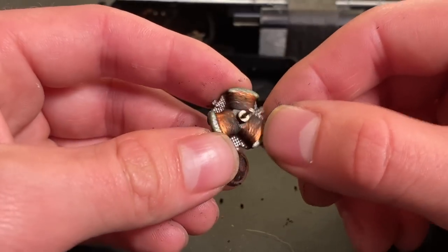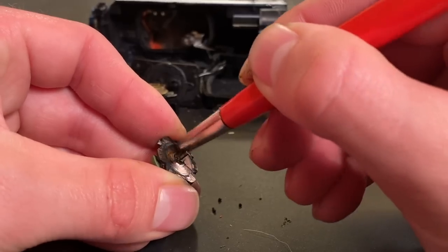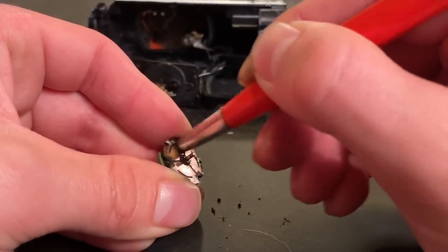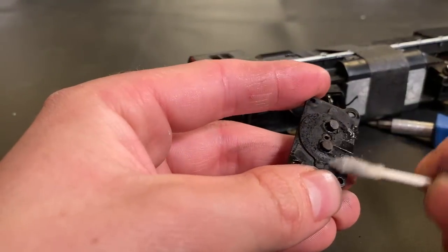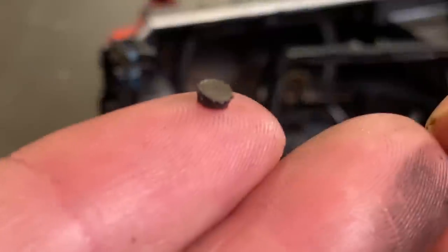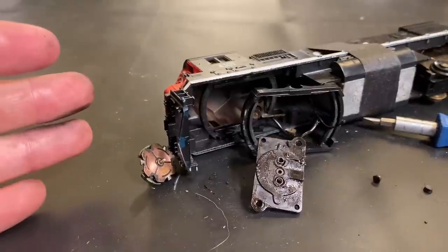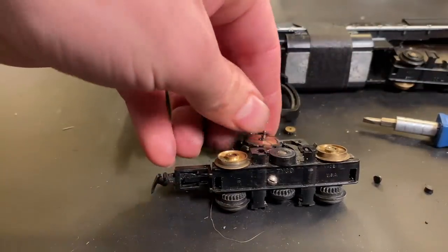This is definitely a motor which has overheated at some point, but it was running, so I think we're just going to clean it up and hopefully this motor will still work. Let's try to remove a lot of the carbon buildup. I suspect the reason there's so much carbon buildup is probably because this engine did a lot of miles - somebody really just ran the bejesus out of it. I'm going to quickly try to clean up some of the carbon buildup on all these plastic parts here. It would be good to clean the brushes up too. You can really just see by how thin the brushes are that this thing really was run a lot. It's kind of unfortunate seeing an engine in such rough shape, but at least you know somebody really got a lot of use out of it. If this engine could tell stories, I'm sure it would have a few. Let's try to get this motor all back together.